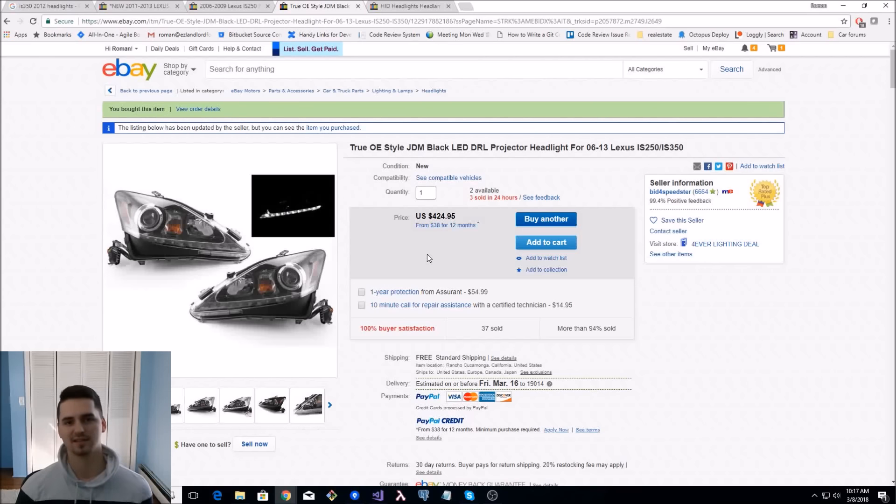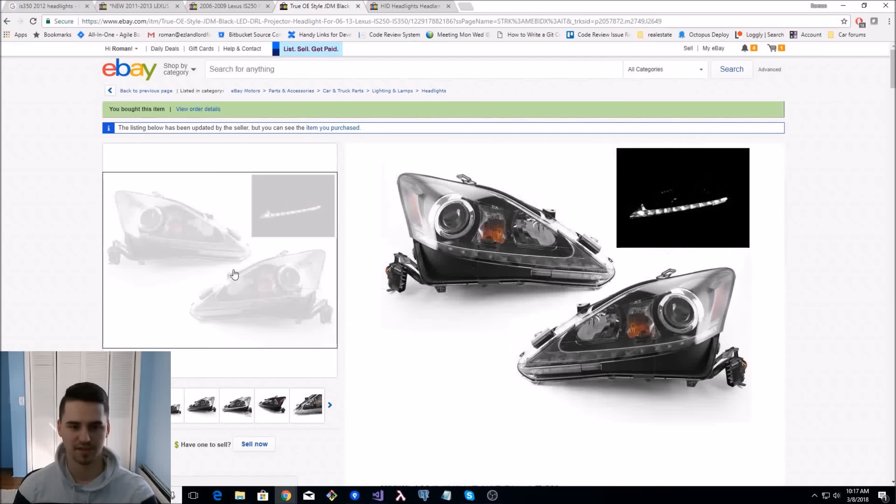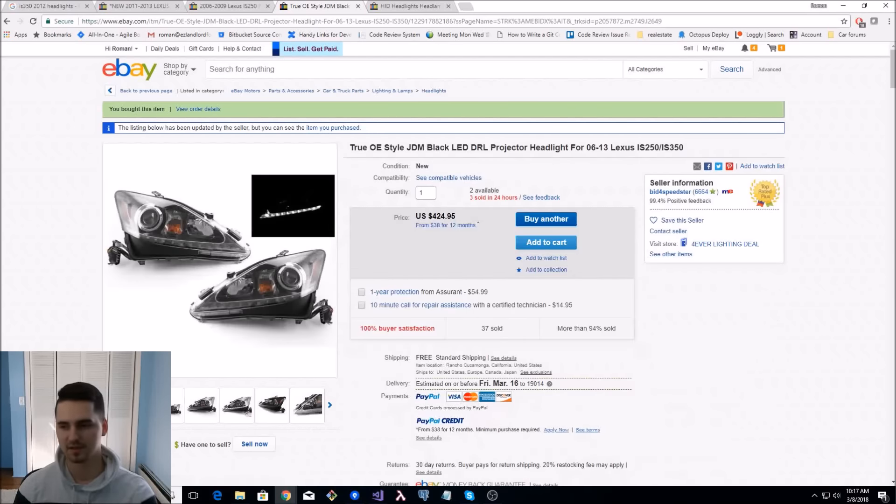The purpose of this video is I wanted to see if I could buy these $400 ones and fit them on an HID model like I have. If you're watching this and you have a Lexus IS 250, 350, or ISF, chances are you have an HID model. I just wanted to show that you could actually get these headlights on your HID model car and save almost $600. The catch is obviously your AFS function won't work. But if you own a couple of Lexuses, AFS is a huge issue — they actually got rid of AFS completely in 2011. For me, it's worth losing AFS, the auto-adjusting headlights. Stay tuned — I'm going to show you if these headlights work on an HID model.